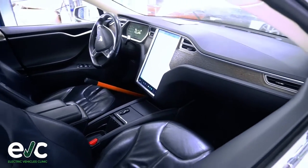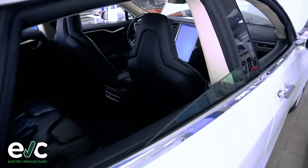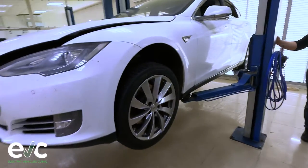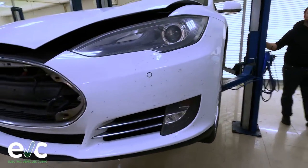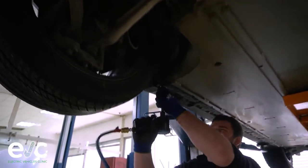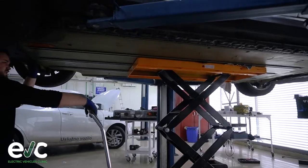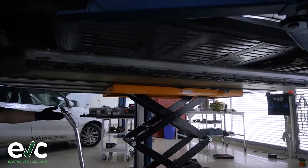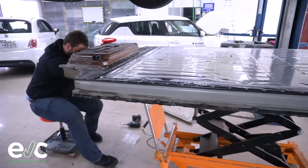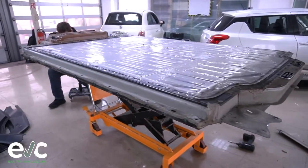There are some errors we need to check related to the isolation. Hello dear customizators — this video is sponsored by EV Clinic. As mentioned in the introduction, this car has an isolation fault. Every electric vehicle has a safety component called an isometer, and that component is constantly measuring the isolation of the high voltage system to the electric vehicle chassis.